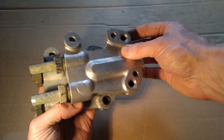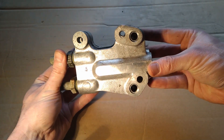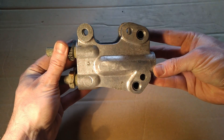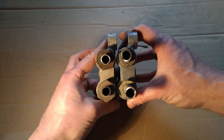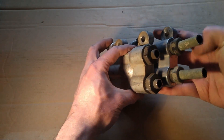So essentially what I'm saying is one adapter will fit onto the other — you could take an LT77 adapter and fit it onto an R380 no problem. The bit where they're different is with the pipes. So really you need to match the pipework to the adapter, not the pipework to the gearbox.